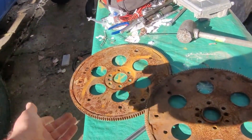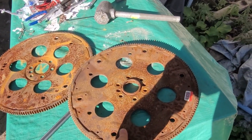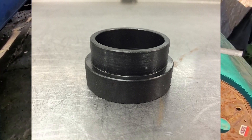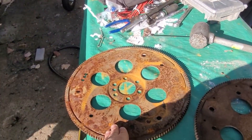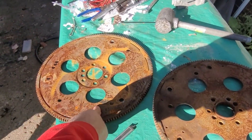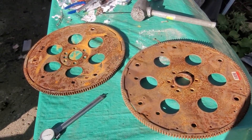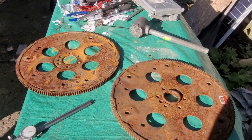So you can put the dished plate in front of a Turbo 400 or Turbo 350 as-is, or use the flat plate with the little stepped adapter. To summarize: 4L80 flex plate, 4L60 flex plate — either one can go to an old-school transmission. The dished one needs a spacer in front; the flat one needs nothing. If you have a long crank engine, you're in luck — all you need is bolts.